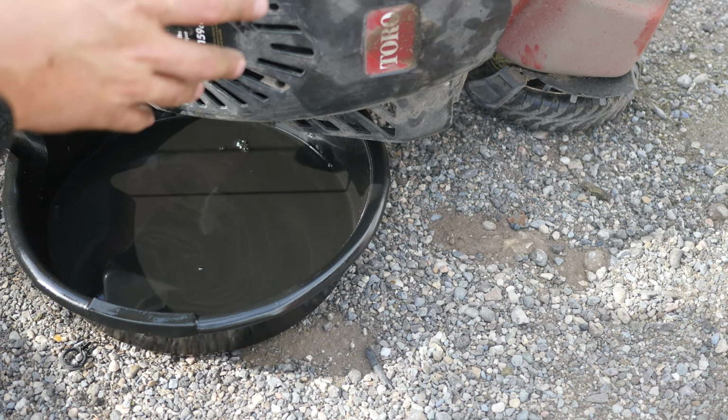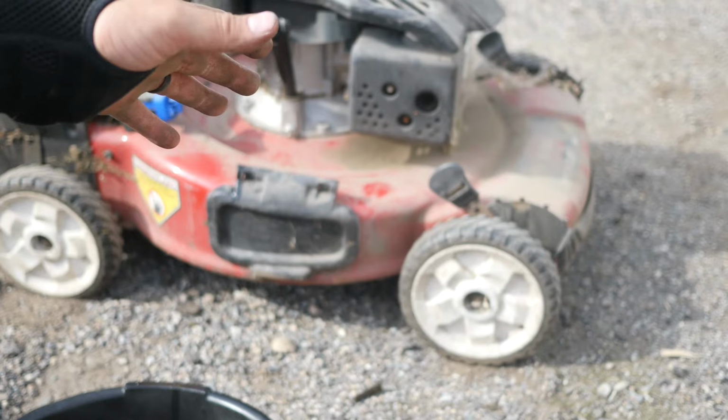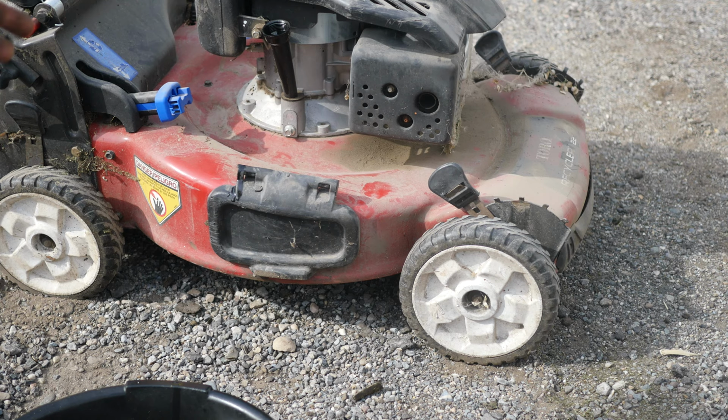a specific temperature range, because they are in water-cooled engines. These are air-cooled engines. These normally just run hotter. They're going to, period. They just always will, unless it's an air-cooled, water-cooled engine. If it's a water-cooled engine, you're probably okay, as long as you don't have any wet clutches like a motorcycle. But if you're air-cooled like everything else, make sure you get specific oils, whether it's made by Toro or Honda or by a different company for small engines.